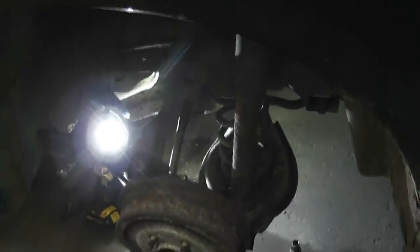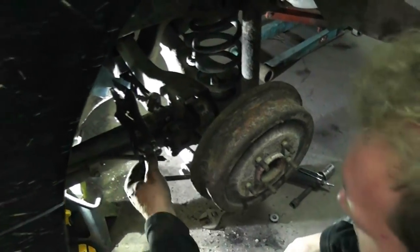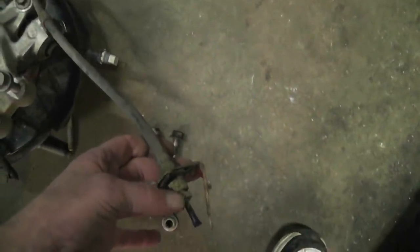So basically, other than that back bolt, the rest come out pretty easy. And it's just a matter of cutting e-brakes and... I just pinched off the line there. Pinched off that line so we don't lose fluid, because the other one here, the flex line, the end has to be changed. This end here has to be changed, and it'll go, it's flex all the way. Like as you see here, there's a hard line and then two flex, but on the new one, it's flex all the way. But other than that, she's basically ready to come out as soon as we lob that off.